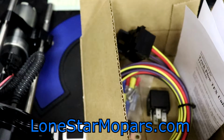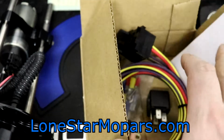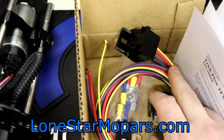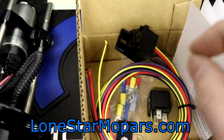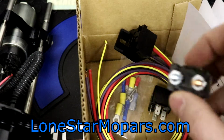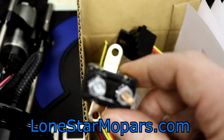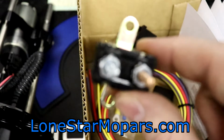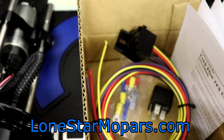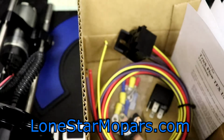That's it. I have to say, I'm pretty impressed with this kit for the price, because for roughly 19 to 25-ish, you get basically the same thing, but with an inferior wire. Having a 10 gauge power wire, 12 gauge wire to the pump, that's where we're getting the bang for the buck out of this kit. Now again, I feel like a lot of people aren't going to be concerned about the wire gauge more so than, oh, what the hell, a circuit breaker, I don't want that, give me a fuse. If that's the case, you can go a different route, but for me personally, I liked this kit. We could wire a fuse in place. I mean, we don't have to kid ourselves, but this is a pretty good value for the money is what I'm getting at.